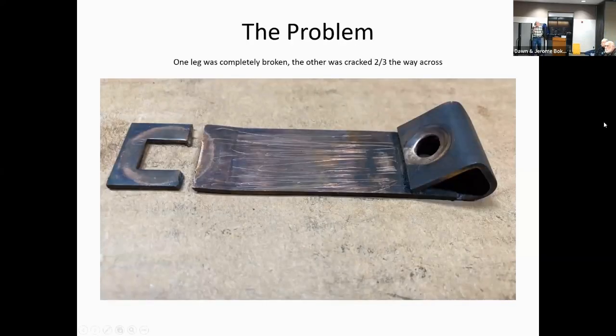Sorry about that. So how many have looked at the inside of the starter switch? Everybody has. Inside there is this beryllium copper spring contact that, when you step on the starter, you're pushing down on this area. This is anchored, and there's an electrical connection underneath here; when it's sprung up, there's another button that it pushes down to, and that's what passes the current through it. Next slide.